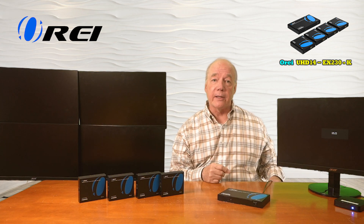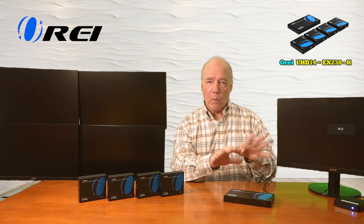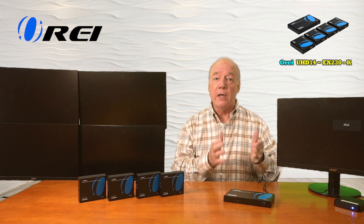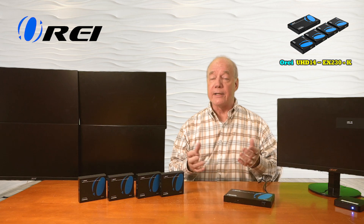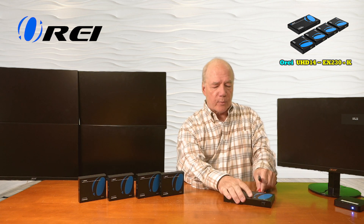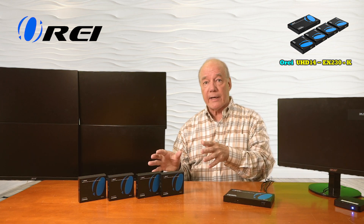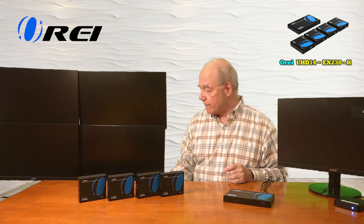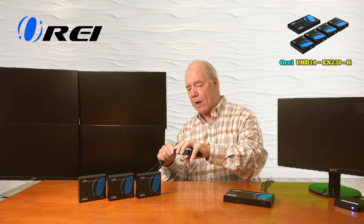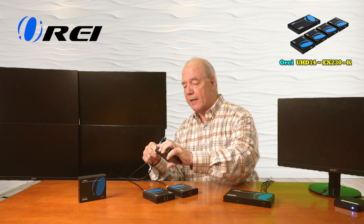Now I can add power — I've already plugged in the power supply, and the other end of that cable has a barrel connection on it which plugs directly into the DC input port on the back of the unit. One really nice feature this product provides is the local loopback function, which allows you to continue to enjoy the content at the primary location while simultaneously sharing it with your four remote locations. To take advantage of that you'll need one more HDMI cable, which you plug into the HDMI output port on the transmitter and the other end into a local monitor at the primary side. Now we're ready to connect the remote receivers up to each of the monitors at those secondary locations. I've already connected four high-speed HDMI cables to the monitors — the other end of these plug directly into the HDMI output port on each of the receivers. It's really important you use a high quality HDMI cable for all of these connections to ensure the best possible picture downstream.